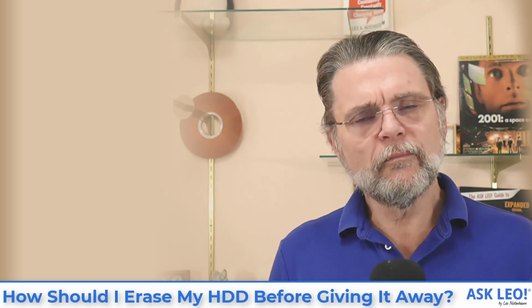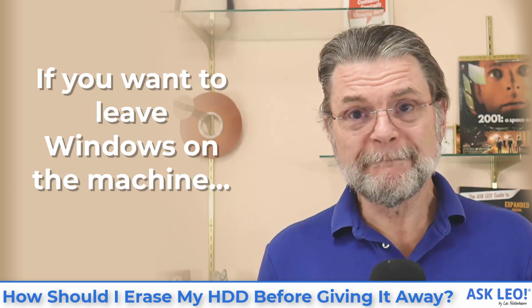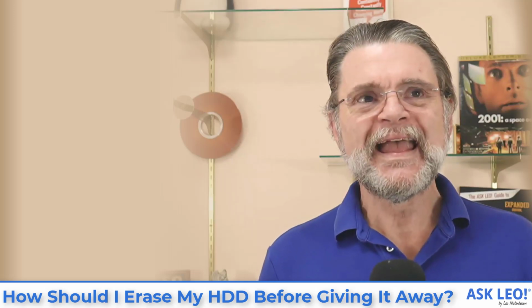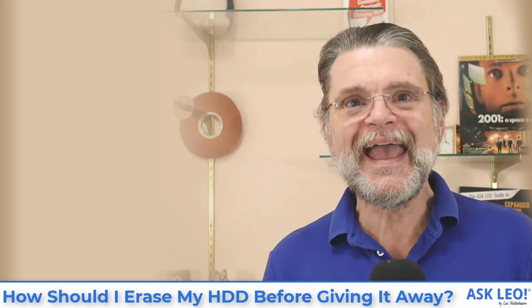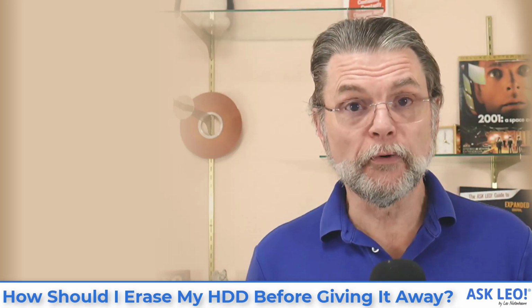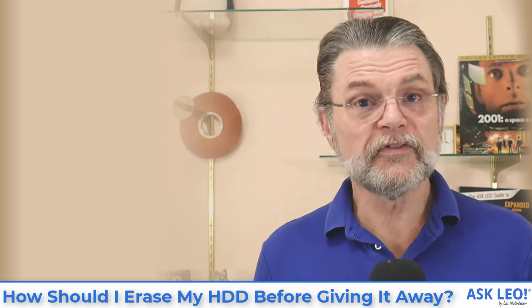Now, there's one more question that I always get with respect to this specific question, giving away a machine. People want to leave Windows on it. There's really only one way to do that, and that is to erase the disk as we have discussed so far, and then install Windows from scratch. There is no way to securely erase everything that matters except for the operating system. There's simply no way to know that something important, something personal, something private hasn't been left behind. So you really do want to erase the entire hard disk and then start over from scratch with a fresh install of Windows.